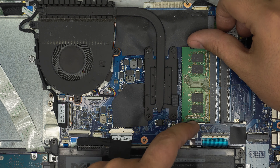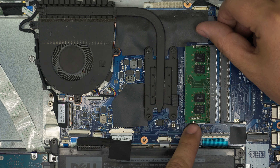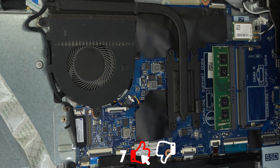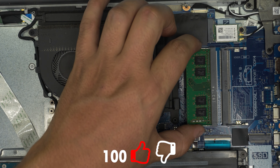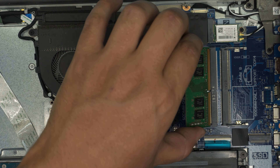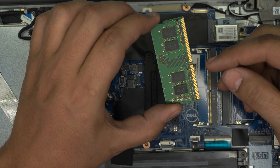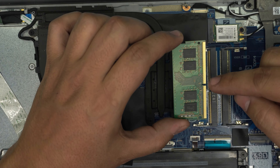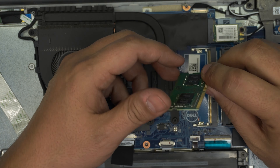Make sure you power off the laptop completely. On the bottom of the laptop you're going to see a bunch of screws — we're going to remove all of them. There are a few screws that, once you loosen them, will not come out entirely — they'll just stick out a little bit. That's how far you want to pull them; don't try to yank them out. Just leave those in place once loosened, and remove the ones that do come out fully.